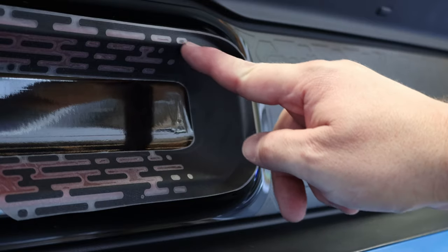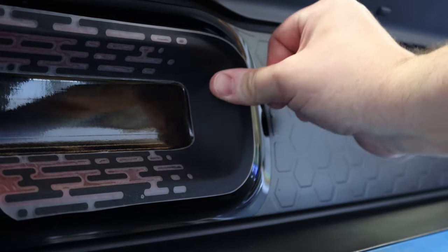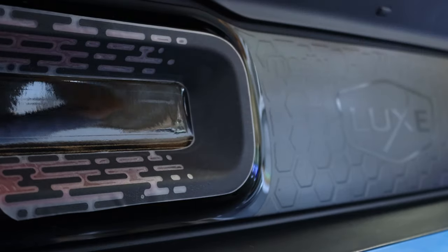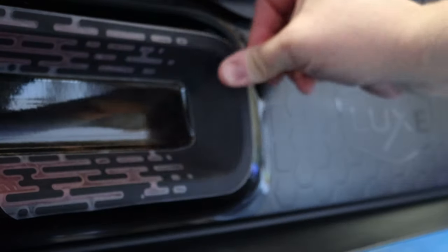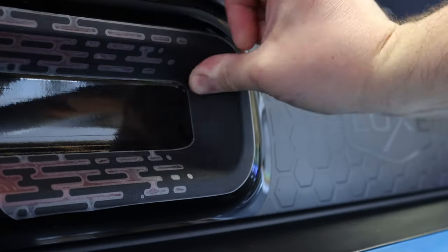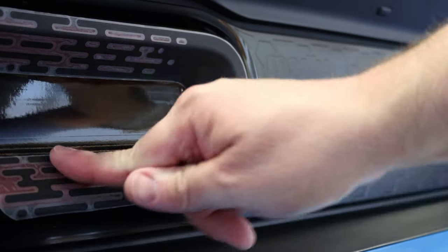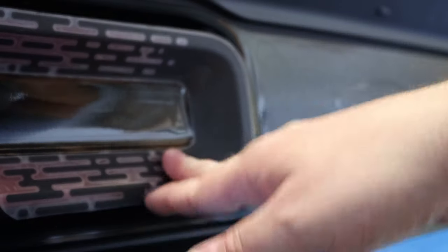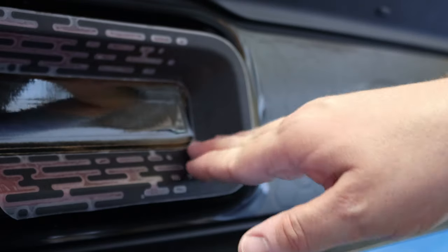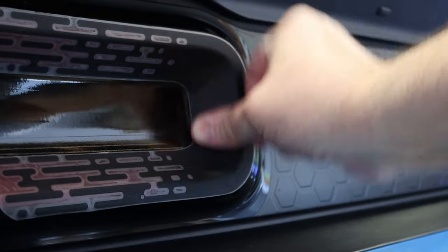Once I get it on there where it looks level to me, I'll come in and work around the center outward, applying a nice amount of pressure with your finger. This is going to stretch the vinyl and lay it onto the taillight. Once you get to the outer edge, work it really well with your thumb or index finger — it's starting to stretch out around there. This stuff goes on the surface so easy. You can see the vinyl basically stretching around and laying right in just like it needs to. Once you've got it all rolled in with no wrinkles, go around and put some heavy pressure. You can use a squeegee, your finger, a blow dryer, or a heat gun. A blow dryer helps the vinyl take the memory of the shape. If you're using a heat gun, be very careful so you don't melt it.